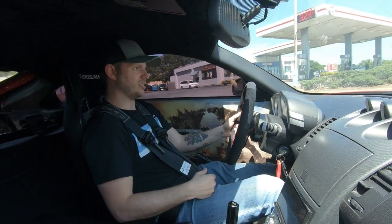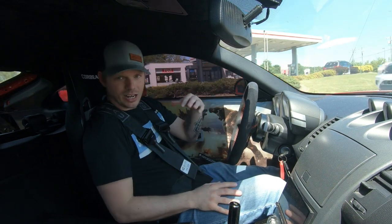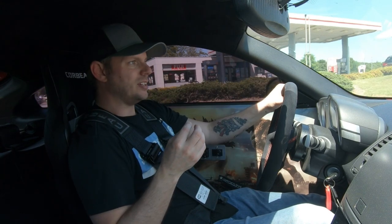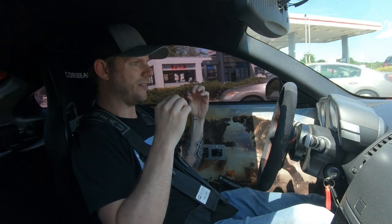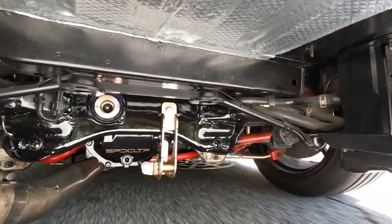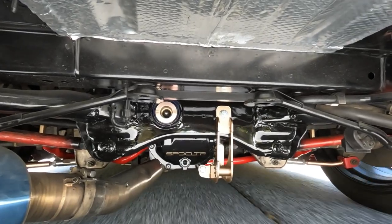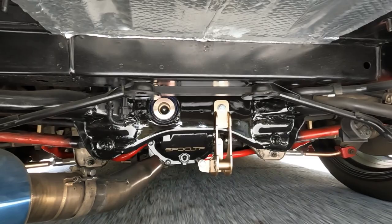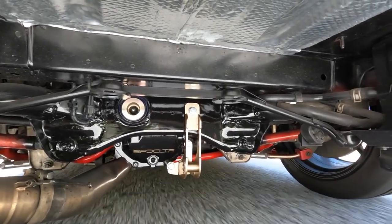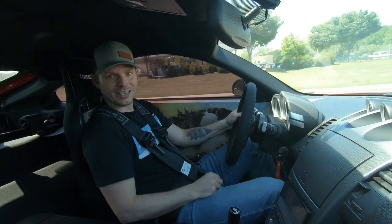Can you tell that they've been installed? Yes, absolutely. I could tell right when I pulled out of the driveway. When you're going over bumps and variations in the road surface — like going in and out of parking lots — I could really feel it going into the steep Starbucks incline this morning. That's when you can hear a little bit of difference too, because you're putting the subframe collars up against the frame of the car — metal on metal contact. But cruising on the road and on the interstate, there's no weird vibrations, humming, noises, creaks, or groans. It's a comfortable ride when driving normally. You can feel the extra rigidity in the rear end, which is what you're going for. This upgrade isn't to make the car more comfortable — it's to make it perform better. The rear end just seems more planted and more connected to the road.